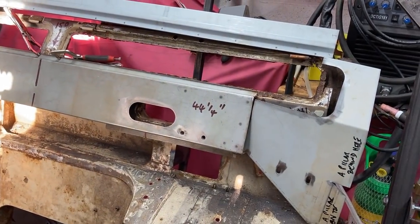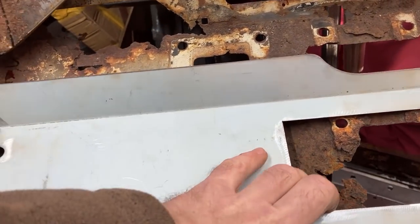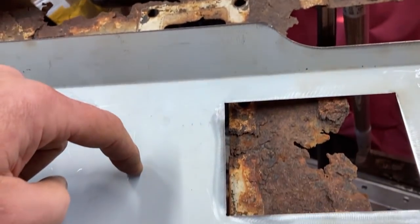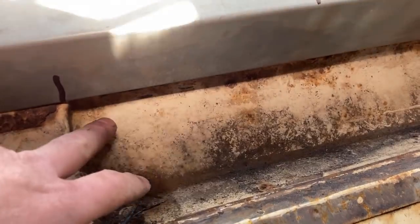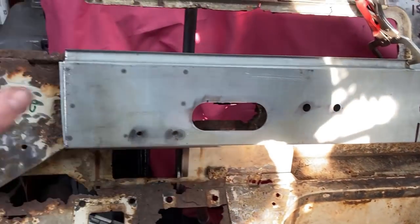Looking at the inside piece — albeit from the opposite side — you can see roughly where it comes to. So it's basically giving me the replacement steel for along this section here, which is what this is ultimately going to glue to. I can't stitch that bit on until that bit's on, and vice versa. But this bit stays — so if I can get that lot in and held, with that modification on the end there, that effectively gives me one panel held onto the middle section. And then I can start working out my distances to pick up these side frames welded to the front face.